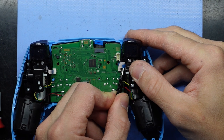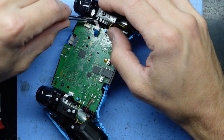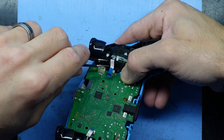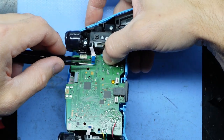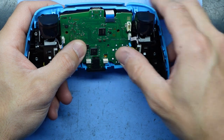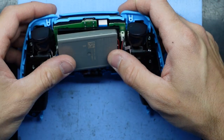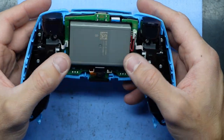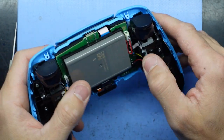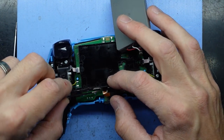Slide that back in here. Now I'm going to use gamepadtester.com — hardwaretester.com slash gamepad — to check it out once more. Funnily enough, I have it working now. The D-pad down is working. I'd say this cable here, from whatever the impact happened, had loosened it just enough that it wasn't functioning.